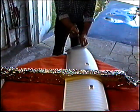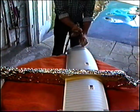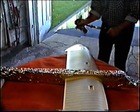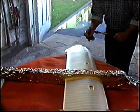Use the lowest pressure you possibly can to get a nice flow out. Extra pressure just gives you orange peel, and orange peel has to be sanded. You can see with all the extra pigment that's in here, this just covers, and it's really bulletproof stuff.